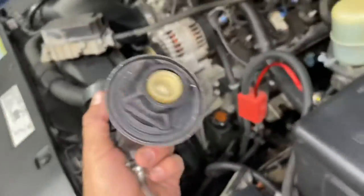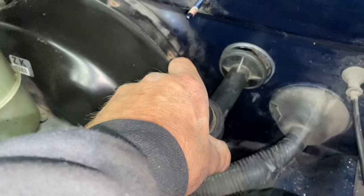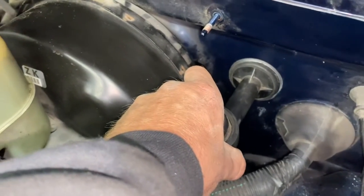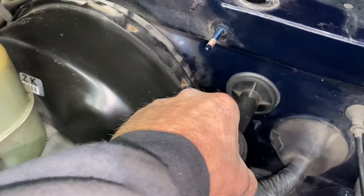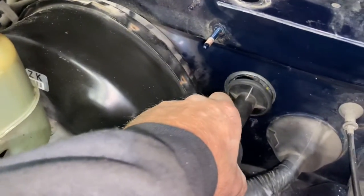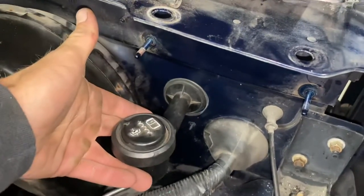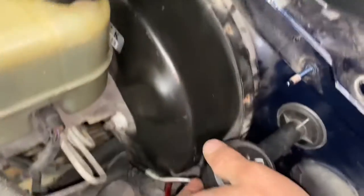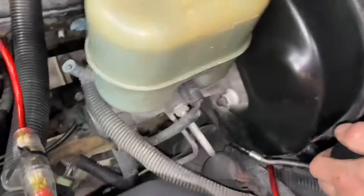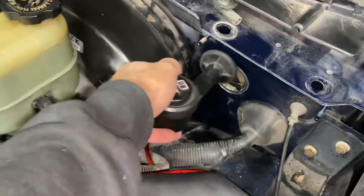I took apart the old master cylinder. You guys can see, I went ahead and took the rod out and everything, but I just wanted to test fit just to make sure that it's going to go in there. It's going to be just fine. I'm going to figure out a way to touch up that little bare metal spot, because that kind of looks bad now. You're not really going to be able to see it anyway, but that kind of gives you an idea of where the master cylinder is going to sit, just like that. Pretty dang easy, guys, and then that just routes straight down to your slave, or actually the slave cylinder line routes up here to this one. But pretty damn easy. That rod feeds through to your clutch pedal.